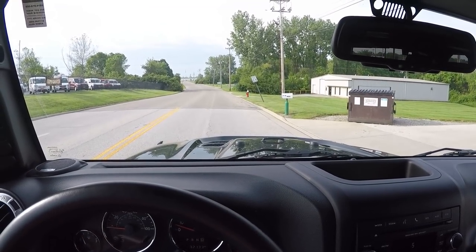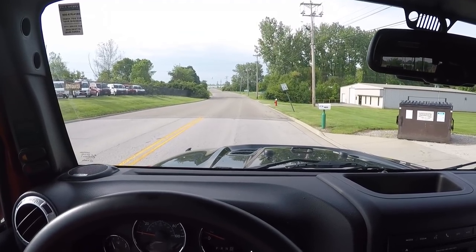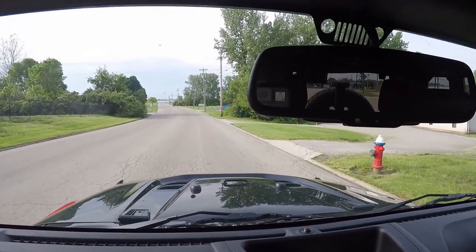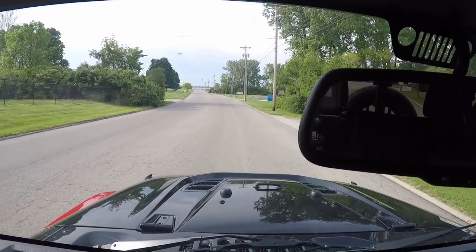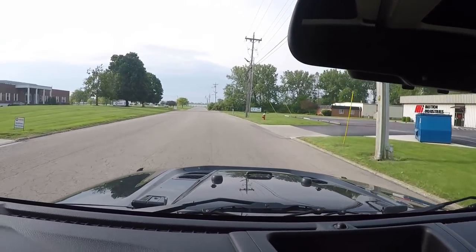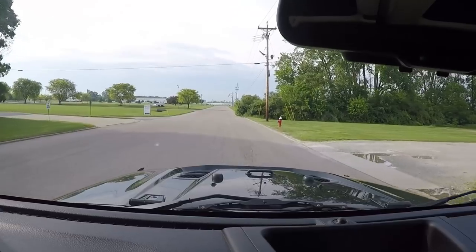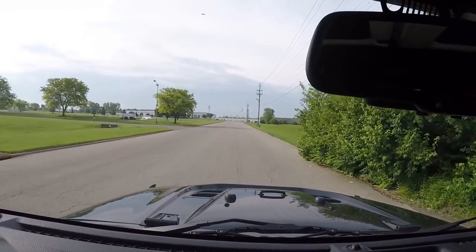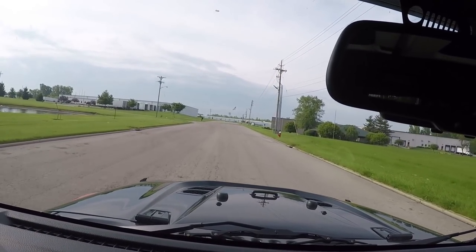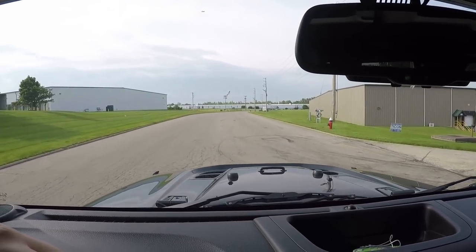Let's go out and get this thing going on a test drive to hear the noise preliminarily before we turn the chassis ear on. We've got the GoPro action camera here for some tools in action. We're going to be driving down a nice even road to see if we can get you guys to hear the noise. We were hearing that one at about 12 miles an hour. Now picking up speed — and there it is at about 33 miles an hour. We hear some wind noise, and we hear our noise — and I'm not sure where it's coming from. This thing is just resonating literally all over the Jeep.